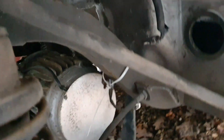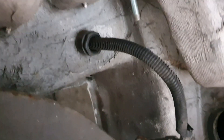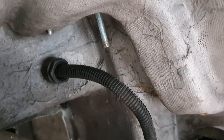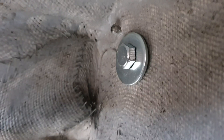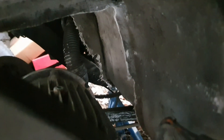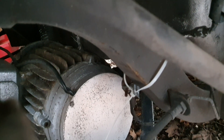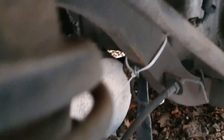That's everything done, so I'm just going to get the wheel arch back on. With the wheel arches off I can get under there, so once everything's done I might take them back off and see if I can get a nut up there to screw the battery bank down on the other side — just to be extra safe. The most important part that's fixed is in the back, so it doesn't lift up and go into the driver if you hard brake. As you can see, there is loads and loads of airspace now, and I'm hoping that solves the potential cooling issue with the motor.